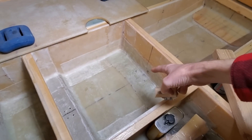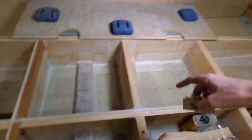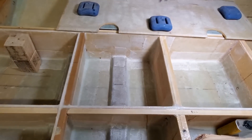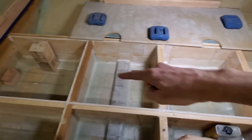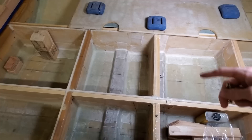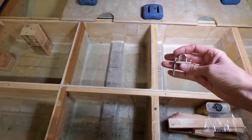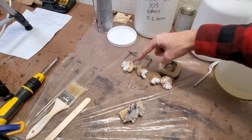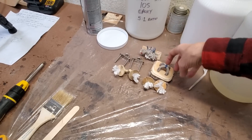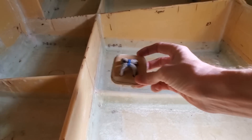This one is going to go in this corner here — that'll connect to a seat belt I got that'll keep me in place when I'm sleeping. There'll be another seat belt here and another one later in the video. Now, this area won't get a rope tie-down mount because I've got the oak keel support beam, so I'm just going to use a typical stainless pad eye with a longer bolt. And then the last type — I call this a spider mount. Four of these spider mounts are going to go back here in the aft cargo hold, one in each corner.